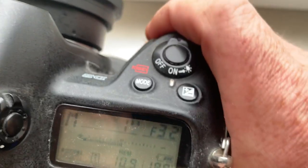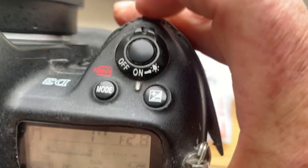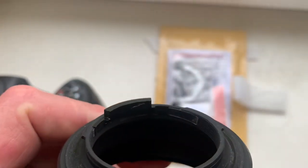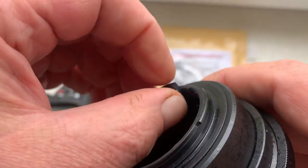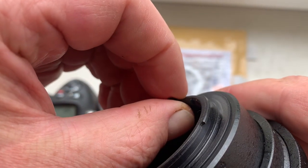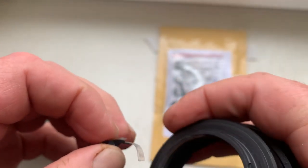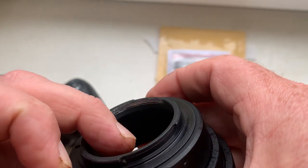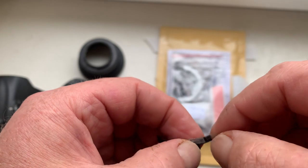When installing on double-sided adhesive tape, mark the borders of the chip. Then remove the chip from double-sided adhesive tape, remove the double-sided adhesive tape, degrease all places, and install the chip with help of super glue gel.